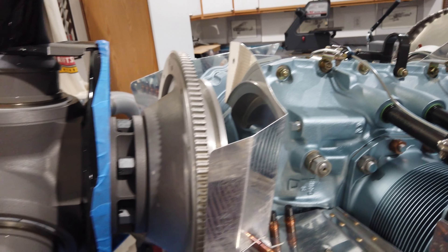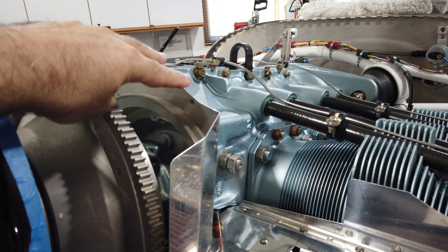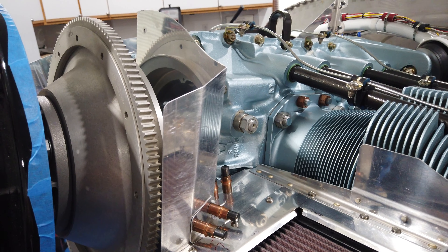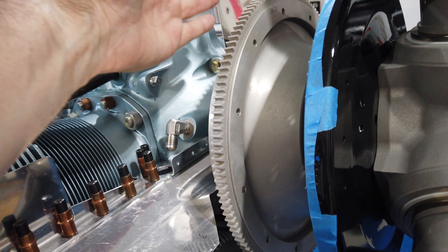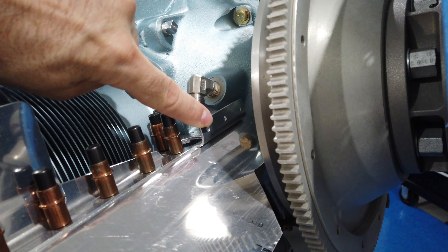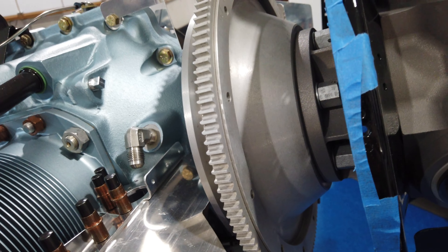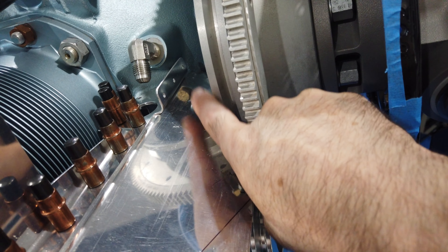These are a little different from what's shown in the plans as far as the angle brackets go. It's been trimmed — I slowly trim it down until I can get the top cowling on. Once I can fit the top cowling in place, I put paper clips around the top edge, put the cowling back on, measure from the very top of each paper clip down three-eighths of an inch, and make a tick mark. I connect the dots and that becomes my cut line for the final trim. You can see it's shaped to contour the top cowling, with a gap of about three-eighths of an inch.